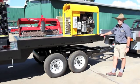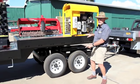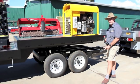The advantage of a dog trailer is it's like two trailers. You've got this trailer here which you've been towing along behind the vehicle, and the weight is totally in the middle, so that trailer actually just rides along and there's no drawbar weight. So you can actually tow a much heavier trailer and not hurt the vehicle that's towing it.